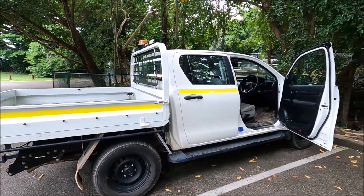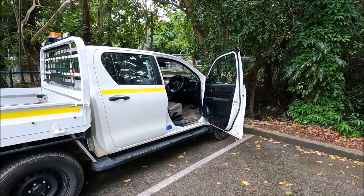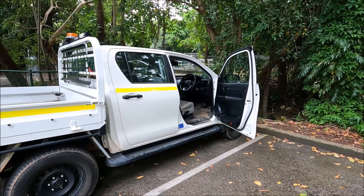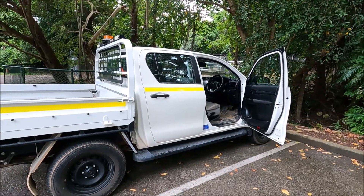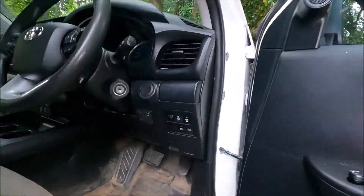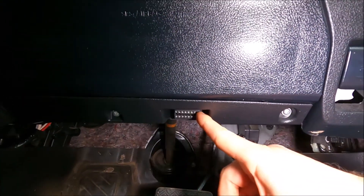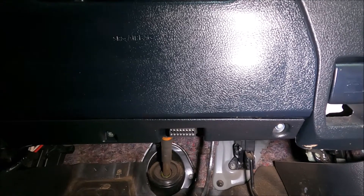In this video I have a 2019 Toyota Hilux and I'm going to show you where the three fuse boxes are and the OBD2 diagnostics port. There are actually two fuse boxes in the car and one underneath the bonnet. The OBD2 diagnostics port is on the driver's side, or right hand side of the vehicle, just underneath the dash and underneath the steering column, tucked up there nice and neat.